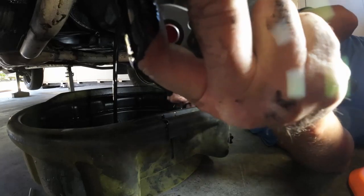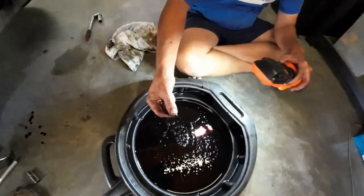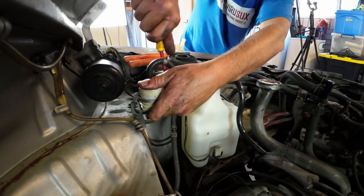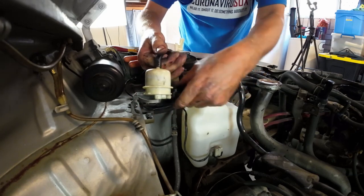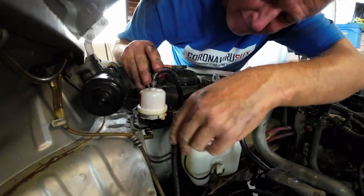There's a crush washer getting buried. The oil that fell out is black and almost sludgy — like the black hole of Calcutta. It's thick. I'll get rid of that and then we'll do the gear oil. Jordan's done the plugs. I've just dropped the engine oil. It's pretty black and very thick and gluggy, so hopefully there's no sludge in the motor. The gear oil was almost new looking. I'd say somebody did the oil change just before the car went into storage to address the third gear issue. We struggled also to find the gearbox fill bolt before we noticed that it has a dipstick just like an auto — that's a first for me.